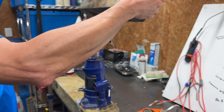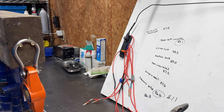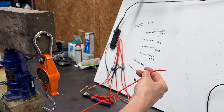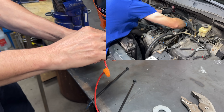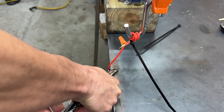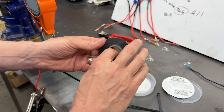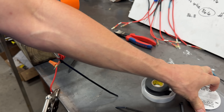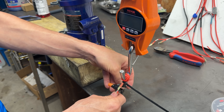Now it's time to have some fun — we're going to break all of these connectors using this weird looking rig. I've got a scale on there to see how much tensile strength each one of these connectors has. This connection strength is very important in automotive applications because you've got so many moving parts, and when you're working on stuff you need to move things out of your way without breaking anything. I remember on the headlight connection they had a couple pieces of electrical tape wrapped around that wire nut, so let me do that — because this is science and we want our testing methods to be as accurate as possible.